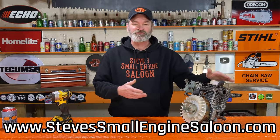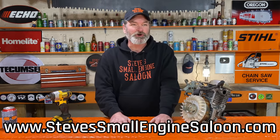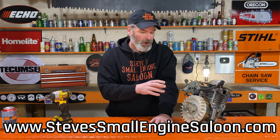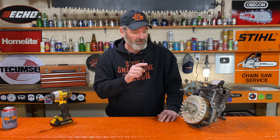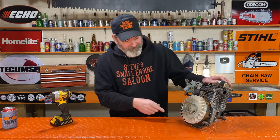The reason I chose this one to do this demonstration on is because Hondas are known for their flywheels being stuck on there really bad. If you have a Briggs and Stratton engine or a Tecumseh engine on a lawnmower or whatever, they're pretty easy to take off. Even your weed eaters and your chainsaws aren't that hard. But these ones are always stuck on here really good, so we're going to try it on this one because this is the worst one ever.